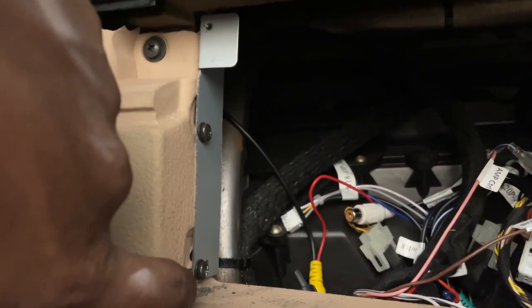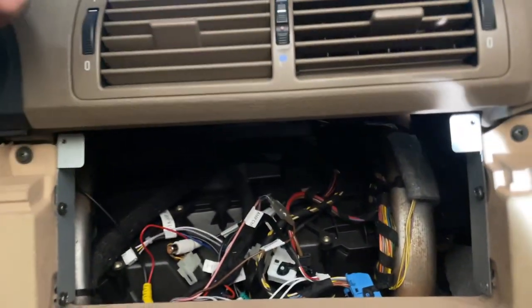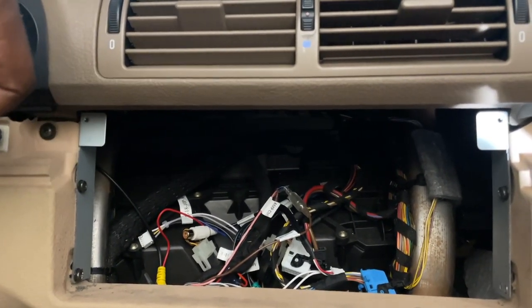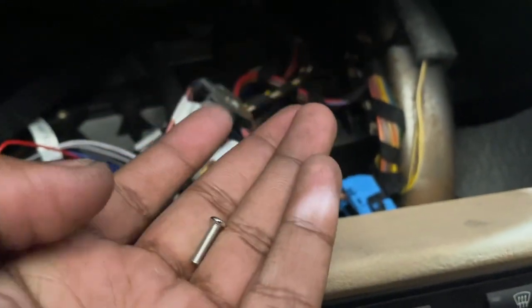and just kind of go all the way down as far as you can. I kind of mounted it flush with this area where the trim goes, same on both sides. And now it lines up perfectly with the screen. So I'm gonna plug everything back in the screen and screw it into these holes right over here. There are two screws for the screen that look just like this. And once those are in, you can put the plastic caps back on.